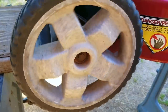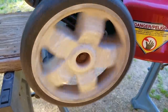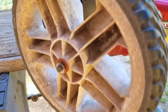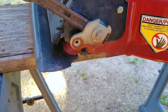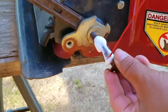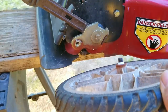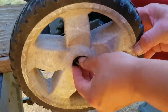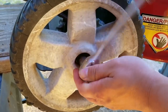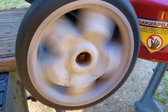The larger rear wheels don't have a major issue with spinning, but are showing some signs of not spinning smoothly. I'm going to remove the wheel and look at the bolt to see if there's some corrosion or dirt causing it. Once free from the mower, I can already see some rust around where the bolts go on the height adjusters, and once the bolt is out of the wheel, there's a lot of rust on it as well. After using some brake cleaner and Scotch-Brite pads on the bolt, I'll apply some lithium grease to the bolt and the steel inserts in the wheels before reinstalling. You can use whatever lubricant you have on hand — any type of light oil will do, and even clean motor oil will work in a pinch. After getting the wheel back on, be sure the bolt is tight, then give it a good spin. It's now spinning smoothly and freely.